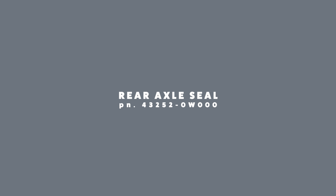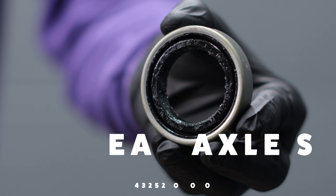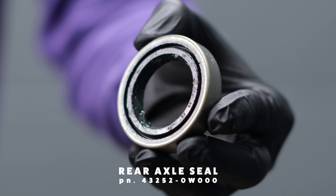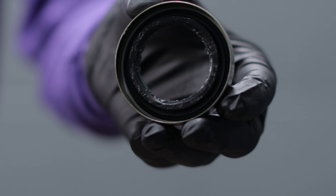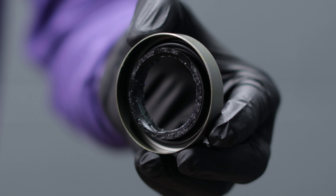Axles don't have an expiration date — they can last indefinitely with proper care. I think you can get more than a hundred thousand miles out of them with proper maintenance. Seals are the weak spot, especially if you go in deep water and take water into your rear axle. That water's going to get in there and push out somewhere. While we're on that — replace your breather, because a clogged breather will cause your seal to leak too. A lot of times people were coming in getting seals replaced and axles rebuilt, and they were putting a new breather on there too. That all falls under maintenance.